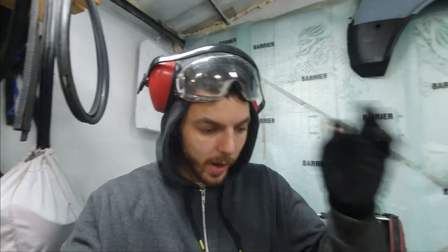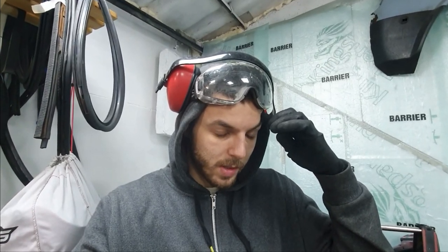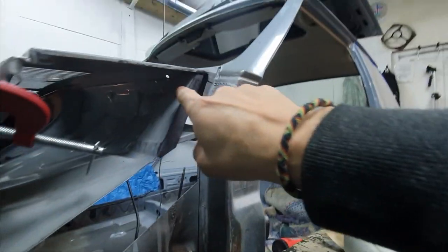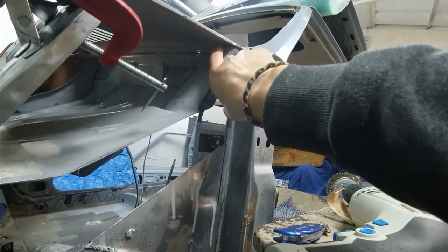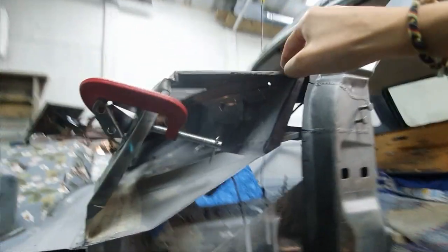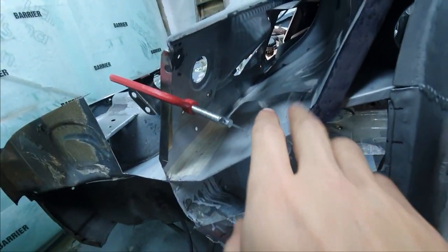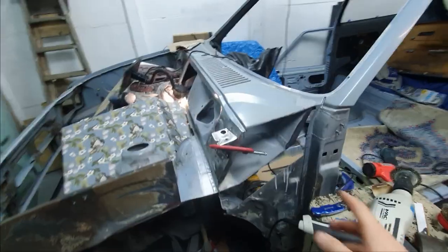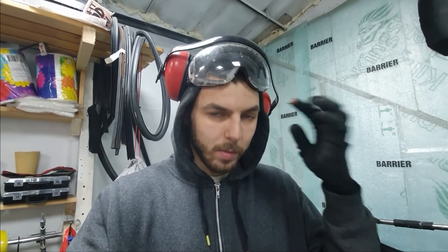As I'm closing up this section I really need to think about every single step that I'm doing so I don't end up shooting myself in the foot. Before I close it, several things still need to happen — like I still need to add a nice thick bead of seam sealer there that bonds this bit to this bit. I need to give it another light sanding inside and give it a coat of paint.